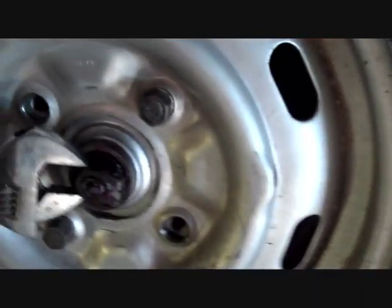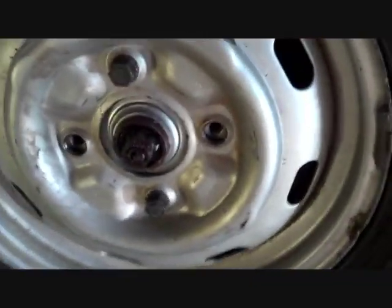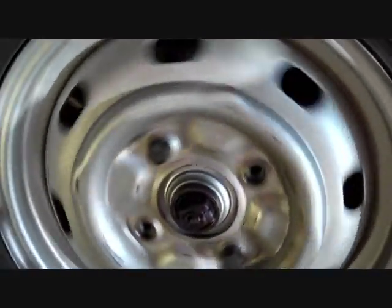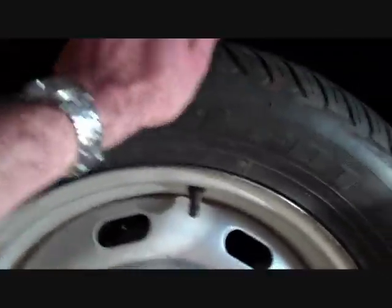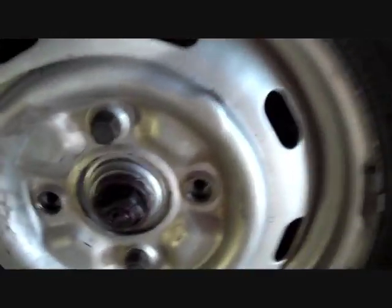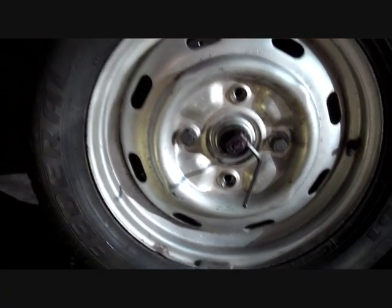You know if you've gone too far, because the wheel just will not spin freely if I tighten that up. The wheel just doesn't want to spin real freely like that. So that is a sign that it's been tightened up too much. So all you then do is just back it off until it spins freely, but there's no play there. And I've pretty much got it on the mark, but I'm going to have to check with two hands. So I've got it at a tension where I'm happy with it.